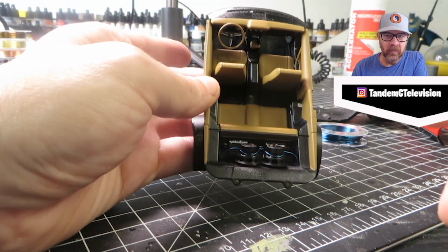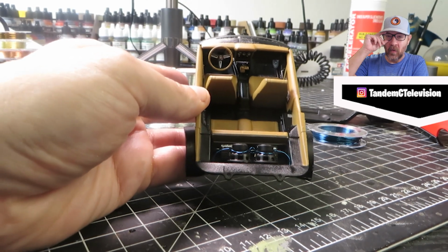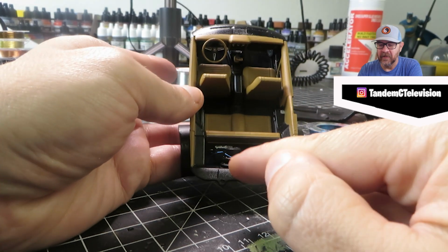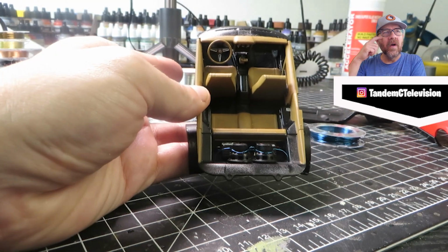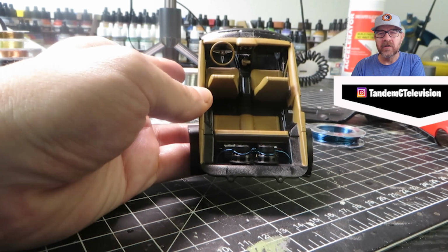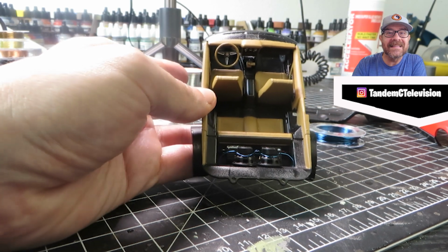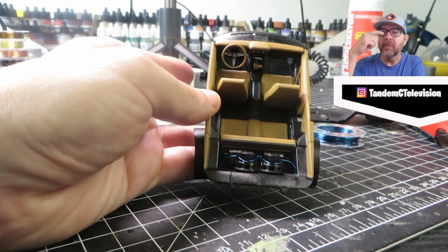Now we get our 1 ohm load going into our amp, getting us whatever gabillions of watts that'll get us, and most likely burning it down at some point. But I thought that looked the best, the most scale, because generally that's why you would run a dual voice coil speaker, so you can wire them in such a way to get the ohm load, or the resistance on those voice coils, down to drive an amp harder, and so on.